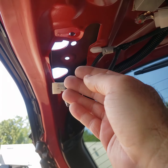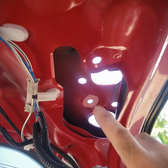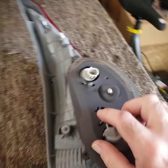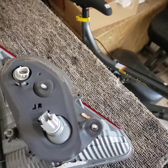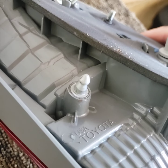The inner taillight part has to come out. It's two 10mm socket nuts — remove the two nuts there, same on this side. Don't forget to unplug the inner taillight assemblies. Kind of wiggle them out after — don't yank on them. Gently wiggle them until the clips release.